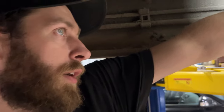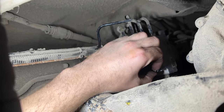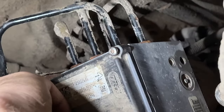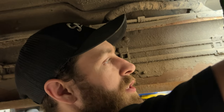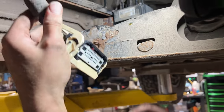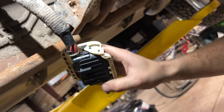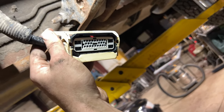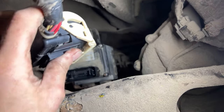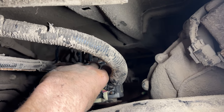There's a circuit board right there. These little bolts get torqued down to 3.5 Newton-meters — not very tight at all. You can just snug them down with a quarter-inch ratchet; just don't overtighten. Then I went ahead and cleaned up the connector — got all the undercoating, dirt, and grease off so it goes on nice, and sprayed some silicone spray in there to help the weather pack seals slide together nicely.